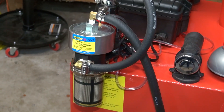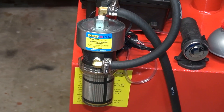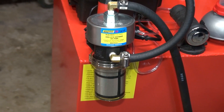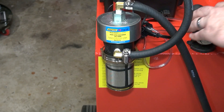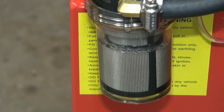Luckily, this fuel pump I found is designed to be installed further from a tank, and upon testing it did have sufficient suction to pull up the fuel from the very bottom, even accounting for the wider tube. Even better, it has an internal check valve to keep the fuel in the tube from having to be drawn up from scratch every single time. And even better yet, this pump has a built-in fuel filter to help clean up any trash that might be picked up from the tank.